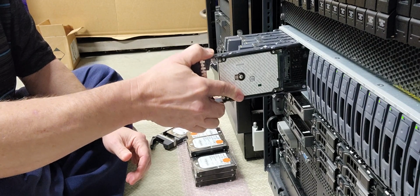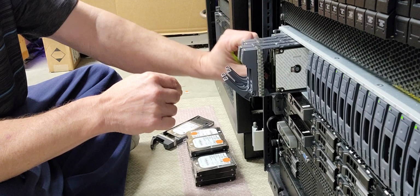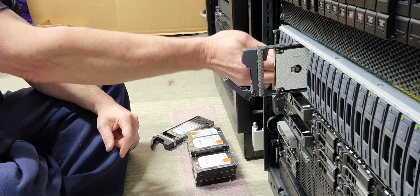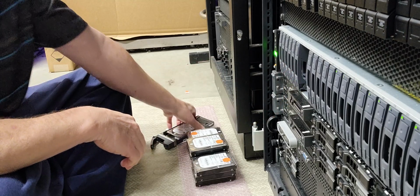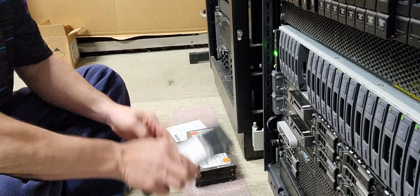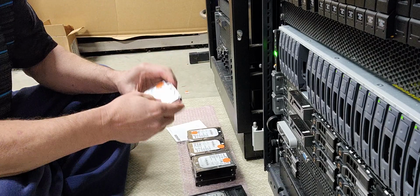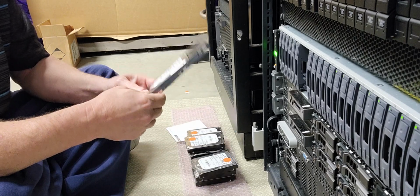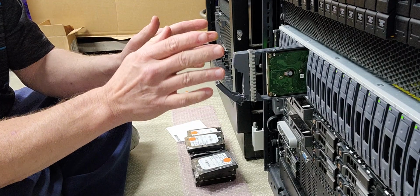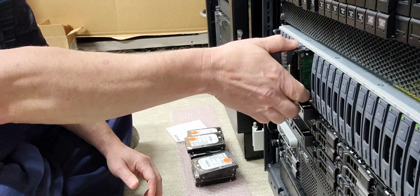All right. And this group of discs right here is the start of the Dell Series 1 terabyte drives. We'll put those in and let them trigger up, and they're spinning up now. Okay. This is a Seagate style drive. It is not a Dell drive, but it is a 1 terabyte drive, and it matches the same classification of the new 10 1 terabyte drives I have here. So these are going to be paired together. Now to do that correctly, for now I'm going to put the lead disk in. Since this is still the same class of drive, same level, it can sit on the same channel or more channels without any impact.